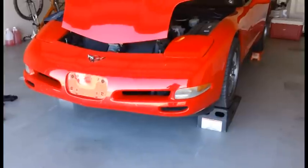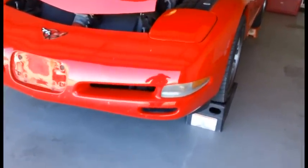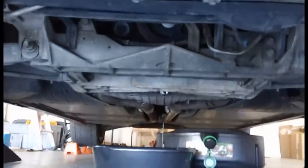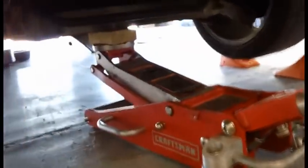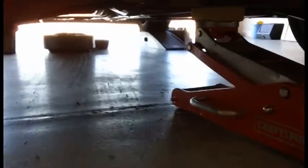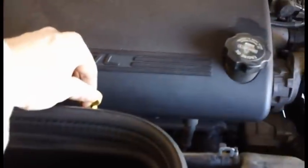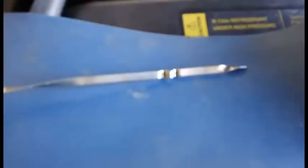This is where the excitement really begins. There's a problem with the Corvette and changing oil — it's so low to the ground that the drain plug is at the front of the pan. In order to drain all the oil, you have to level the car or slope it toward the front so it'll come out of the pan. So I actually have it on a jack in the back and I'm tilting the car up to drain the oil — not a very comfortable thing to do, but I'm very particular about who works on my cars. You just have to be patient and really careful. Now let's pull that back out and check — we're pretty well empty.